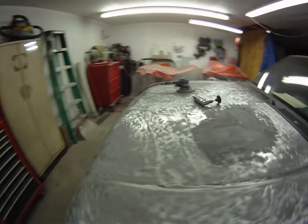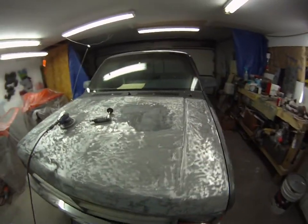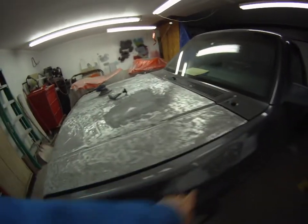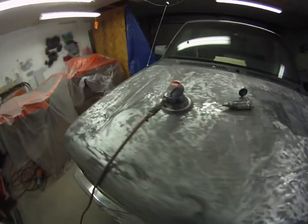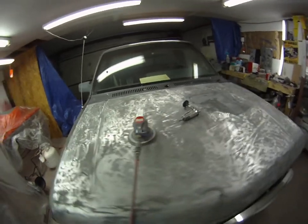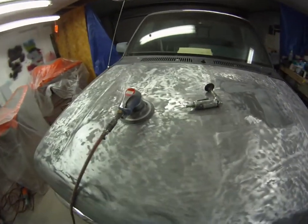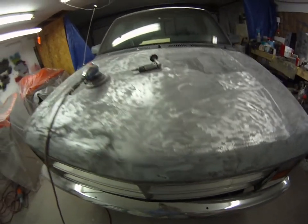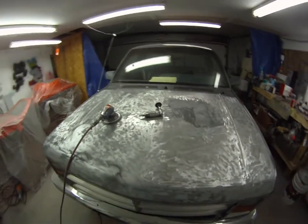So that's where I'm at, that's what's going on. I've got three hours in this thing right now — in the hood and on this little bit right here. So trying to hurry up and get the rest of this ground off, get the rest of it DA'd down so I can get my rust converter stuff on, try to get this thing done. Peace.